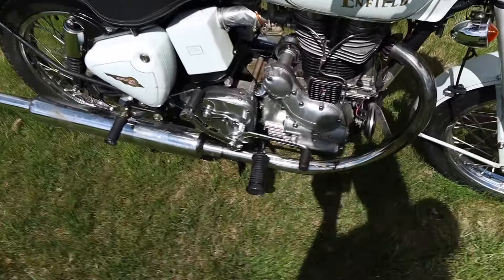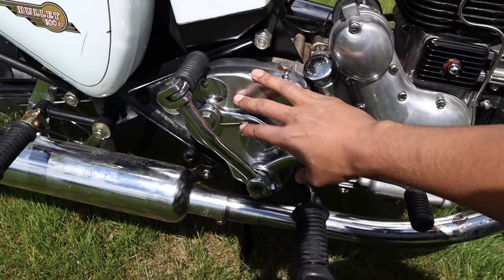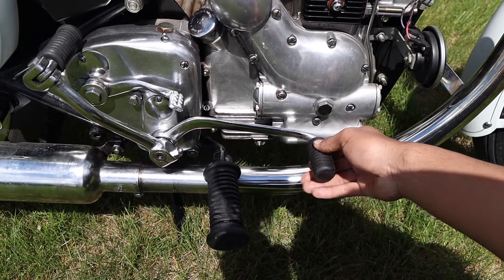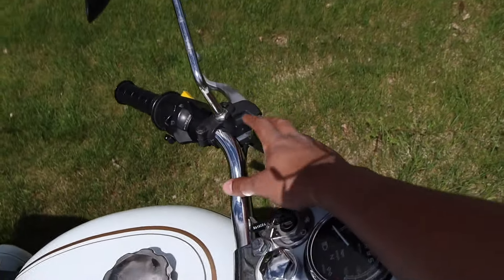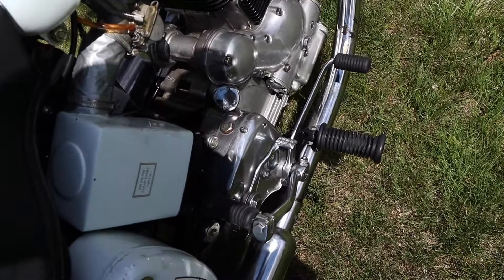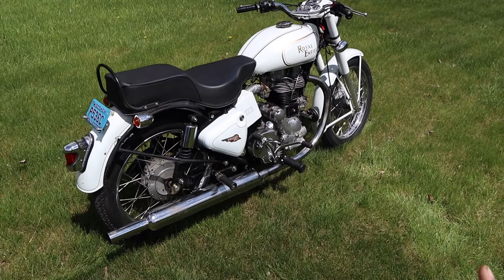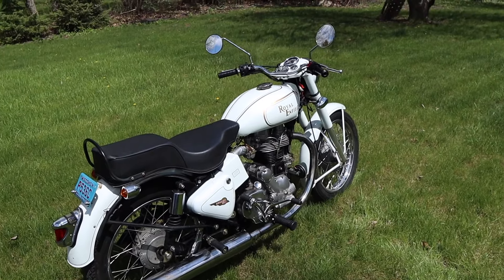After all of that work it brings us to here, where the motorcycle is I would say 85 to 90% done. Last night we did some of the transmission work — we lifted the whole face plate off but we only adjusted the shifter a couple of notches down. The clutch is grabbing way too soon and it's oddly slipping into second gear, so I'm going to have to figure out why it's doing that and take it all apart again. But for now it's running very nicely.